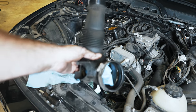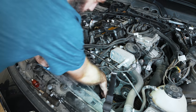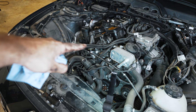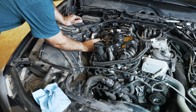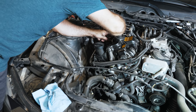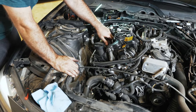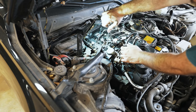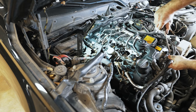Just took that out — it's going to be in the way. We have access to the crank pulley bolt. Next up, we'll focus on removing the valve cover and then we'll raise the car up and drop the oil pan, set our timing tool on there and whatnot. I'm going after electrical connectors where I see them. You have the high-pressure fuel pump connector. I'm inserting a pick tool on the side of the fuel injectors, lifting straight out. Going after the coil. I'm doing the 8mm on top of the injector bracket for the coil ground.